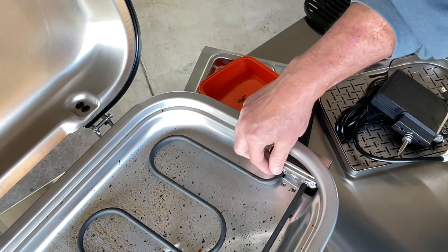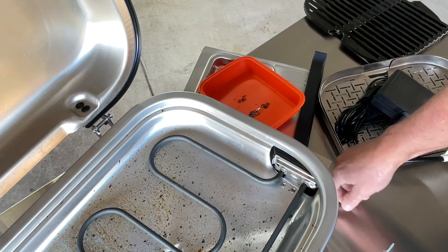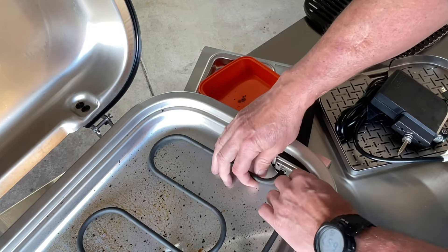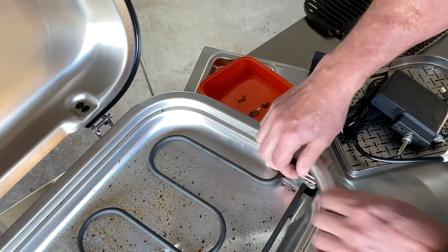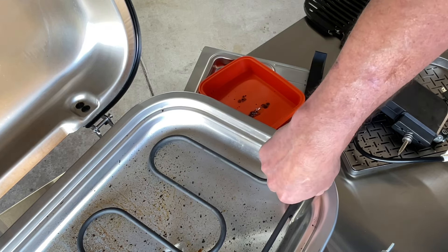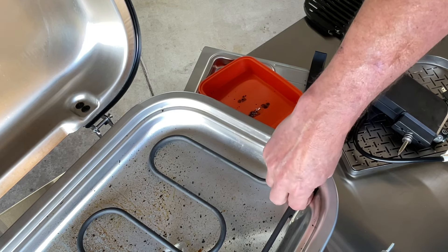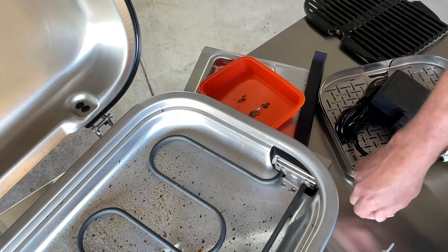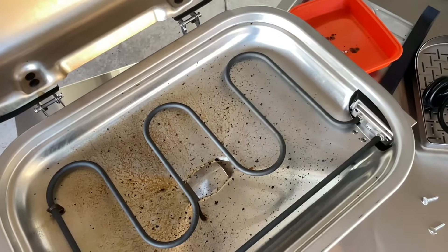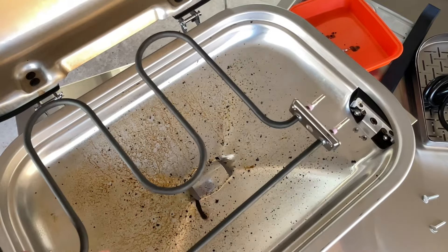You can see they fit right in here. If you want to use the ones that came with it, you just have to remember you need a screwdriver. But having a thumb screw means it's removable by hand. It's a little tight on this side, but I've got big fingers, so chances are pretty good your fingers will reach in there too. You just unscrew it and pull it out like that. And then the whole heating element comes out. Remember, you've got to do this when it's cooled down — wait until the next day. This whole thing just pulls out like this.